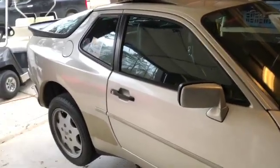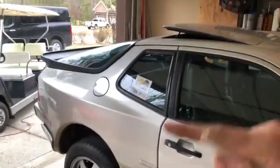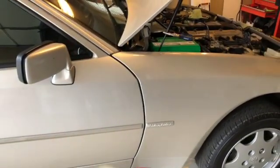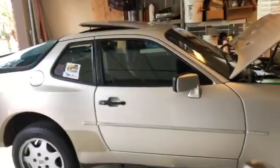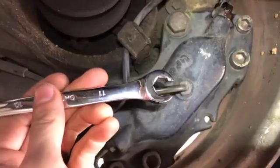All right, so we're going to start in the far back corner back here. So we'll do the back left, then we'll do the back right, then I'm going to do the front right, and then last one is the tire closest to the reservoir over there. And then last, I always do the clutch last. I don't know if that's a rule you're supposed to do or not, but that's how I do it. Maybe I'm just dreading it, and so I don't want to get to it too soon. I don't know, but I always do it last. So anyway, here we go.